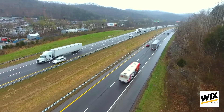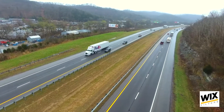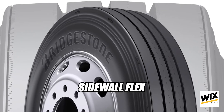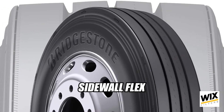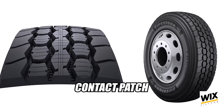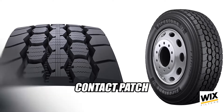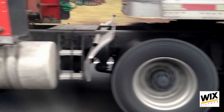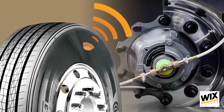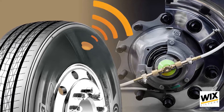When you have 60,000 pounds rolling down the highway at 60 to 70 miles per hour, there are two things that matter. First, how much the tire sidewalls are flexing — because if they're flexing too much, they build up heat and they could fail. The second is the shape of the tire's contact patch. There's about the width of two hands that make contact with the ground, and you want to make sure that is the best possible shape for starting, stopping, and turning. So you're managing the flexing of the sidewall and the shape of that contact patch through inflation pressure.